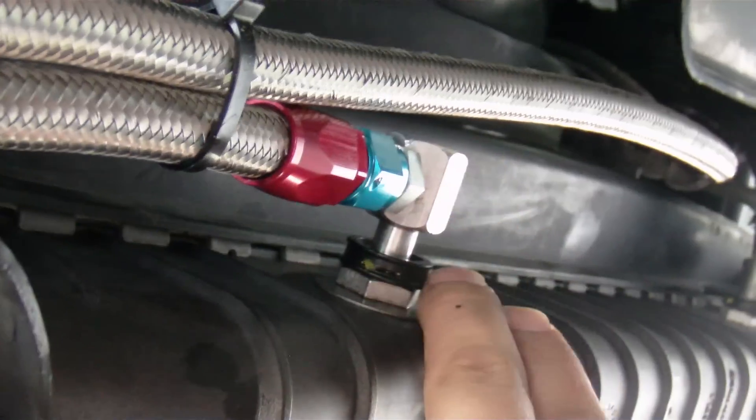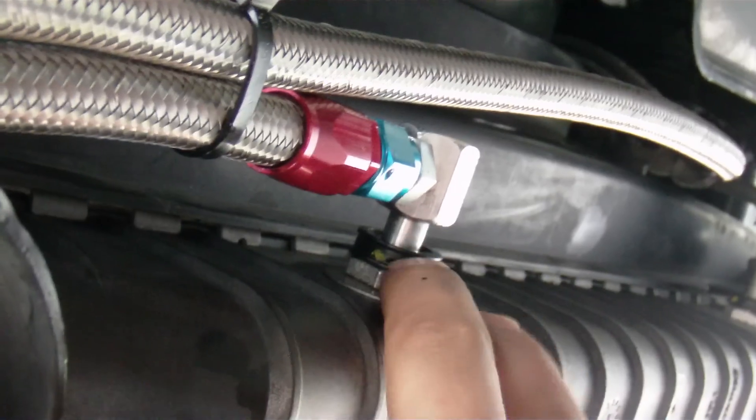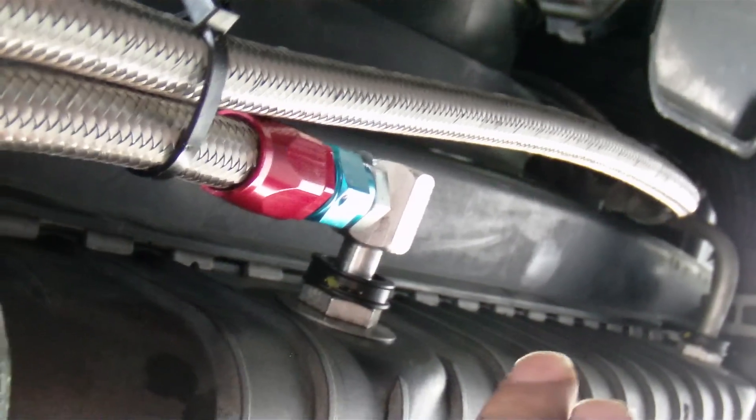Get under here. The short tube — they give you this fitting and it goes right into the GM. It works good. You pull this retainer off, there's an E-clip, pop that out, and the fittings do come out as long as you pull them evenly.